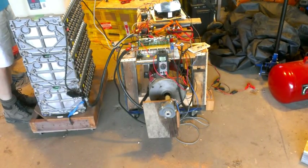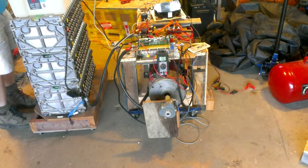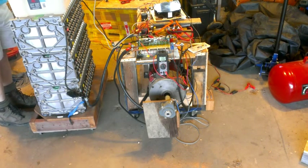I'm just going to recycle power again so I get the controller sign-on. And we'll go config. I've got a raw throttle position of 0, which is interesting. Pi ratio of 62. Power voltage is 124. Pre-charge time is half a second — 5 tenths of a second. And pole pairs is 2.